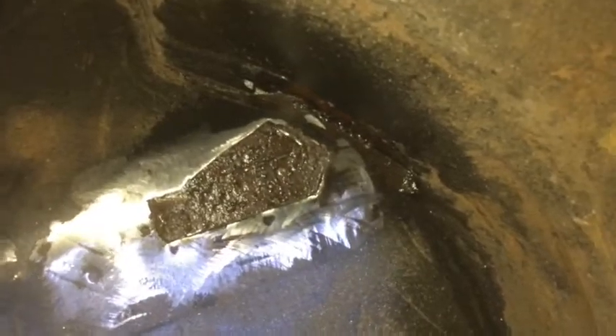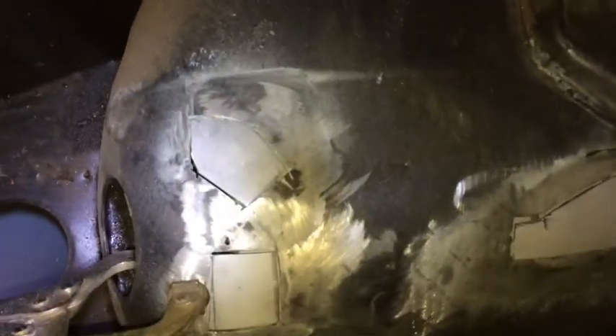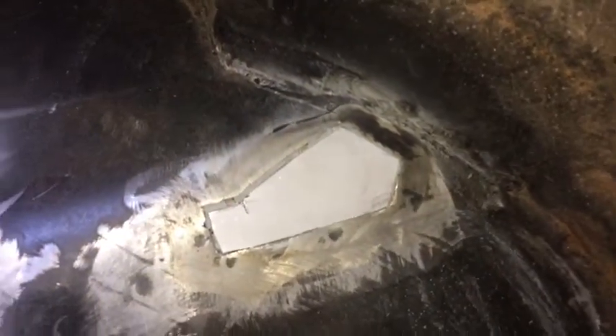I'm on the second shocker tower now, which is not as bad as the first one. As you can see there's a bit of cutout there, there, and there. I've got rust converter on the rusty area in here, and I've just got a bit of paper - rubbed it on the patches - and that's given me the three shapes that I'll need to cut out. I've got my three patches ready; I'm quite happy with them, they fit quite good, and now I'm just about to weld them in.